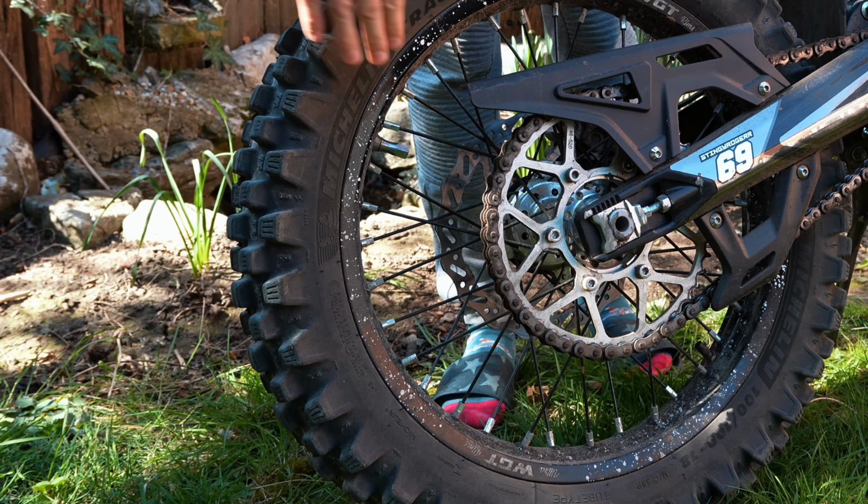So under here we have a custom rear light that I actually made and designed with the help of one of my friends. This isn't one that's been ready bought. This is a complete custom design which integrates using the standard 4 bolt holes, all the existing hardware, and it comes with quick connectors, so you can just quick connect it straight up to the existing light system. So as you can see, we have our brake light, we have our indicators built into it, we also have our hazards. So this is a fully legal rear lighting option that I like, and the best part about this is because it's so low profile and flush, the rear tyre never hits it even under full compression. So that's pretty much it for the back. Nice and simple, tidy and minimalist.